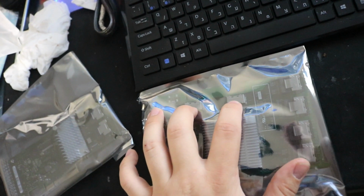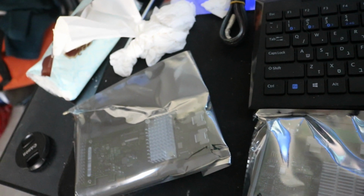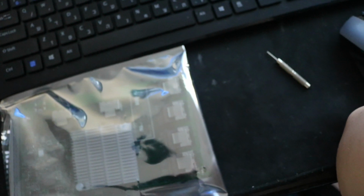These are supposed to connect to the controller, but let me just tell you how it works. If you would connect SSDs, you would need more bandwidth, so you would have to use those two to connect them directly to the controller, to the ports of the controller, and then you could only use 4 ports, which is still good. That gives you 4, 8, 12, 16 drives. It would still give you access to 16 hard drives, 16 SATA ports, which is good.